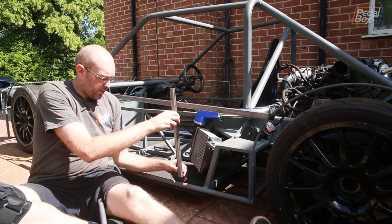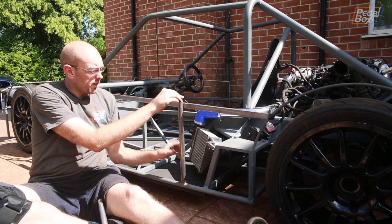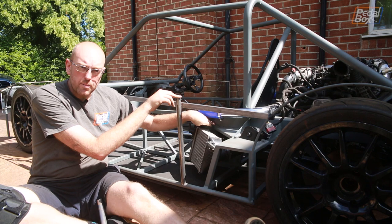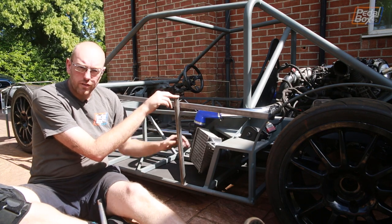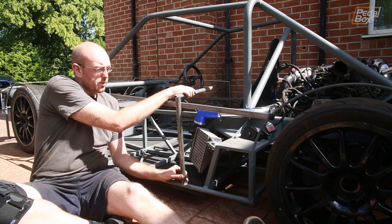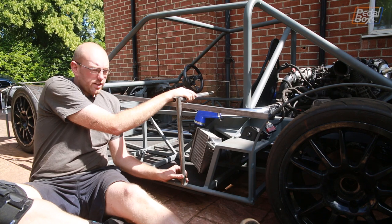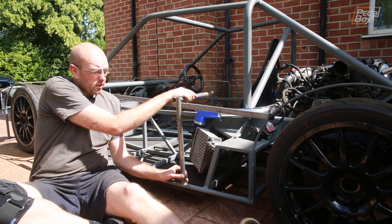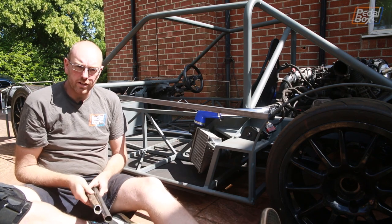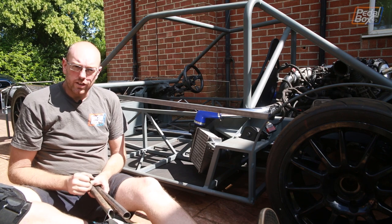I'm going to build this out of inch tube, the same as I did with the structure at the front — that's just going to sit dead vertical up that side and go across here, down in line with this vertical member that sits behind the intercooler from the original chassis. I'm going to join these with some 45-degree slash cuts, which will meet up nicely and do exactly what we need. It's a nice quick fix, and anything else we add can easily be attached to it. I'm going to weld this up into one piece in the garage and then fit it onto the car.